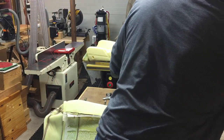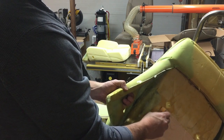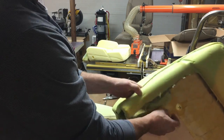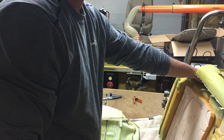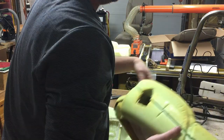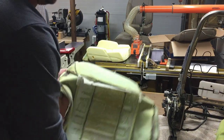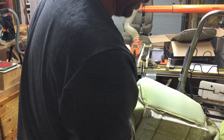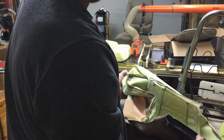And then the seat foam just comes right off. No problem. I'm going to work on taking this off and transferring this over to my new seat foam. Hopefully I can kind of just take a utility knife, it's probably hard to see, there's not good light in here, and work my way around it, and then I'm just going to use some spray adhesive, just like some 3M spray adhesive, and stick it back on there. It's kind of, has kind of a fabric-y thing, and I would guess that kind of slides on the lumbar support. And once again, you'll need to transfer this metal piece off the old one to the new one. This is the only place where you're going to need to do that. And then, at least the ones I have, the clipping mechanism is a zipper on the new one, which is super fun. We'll get there.